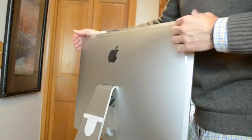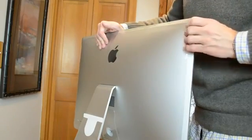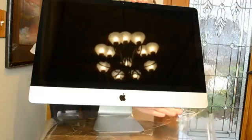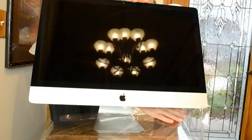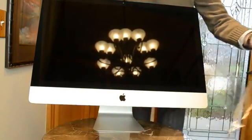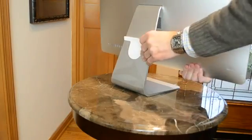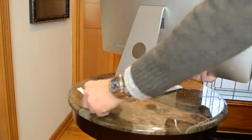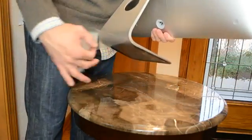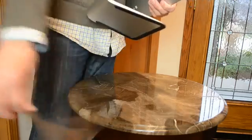Now next up, we have lots of plastic covering the glass panel. We just need to peel it off from around the edges and sides. Incidentally, this plastic panel also covers the RAM access panels just under the hinge of the iMac, so there's a lot more plastic here than on the 21.5-inch model. Next up is the plastic covering the pedestal, and as you might notice, the hinge is still using springs to help hold up the heavier 27-inch iMac — the 21.5-inch iMac doesn't have these springs.